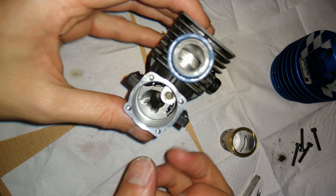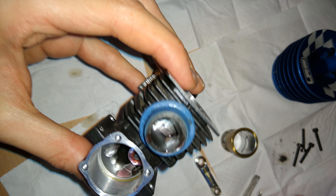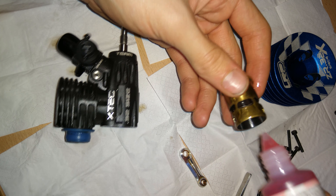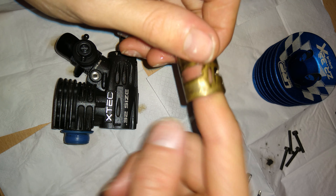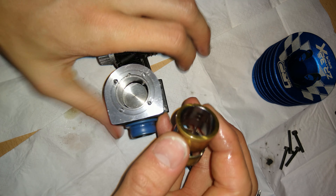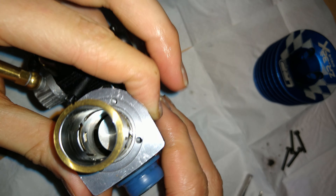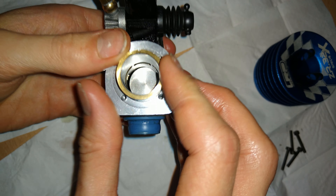We've got the block ready. I'm gonna hit it with some after-run oil because now it's all nice and clean — get it a little bit oily. Then also get the cylinder a bit oily on the sides and the inside. Make sure you have clean fingers — if you have sand on your fingers and do this, goodbye cylinder, you'll have scratches everywhere and lose compression. It's that easy to screw up a good engine, especially a modified nitro engine. These things have no tolerance at all for mistakes.